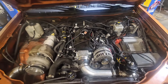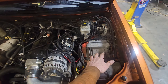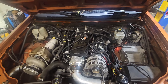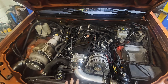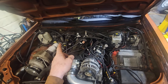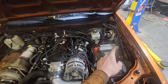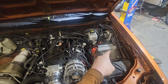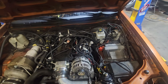You can tell this is a Holley Terminator harness, but then look — there's a P59 ECU over here. The first time I saw the truck I noticed the Holley stuff, then I saw the ECU, then opened the glove box and the Terminator fell out of the dash. It turns out the Holley is not a Terminator X Max, just a Terminator X — so it has no transmission control. They're using the P59 to run the transmission, and they actually have it wired into the OBD2 port.